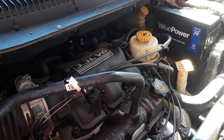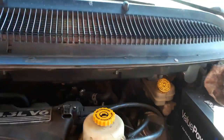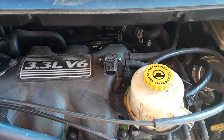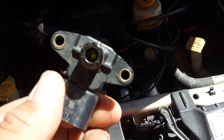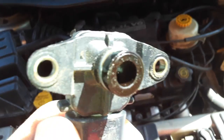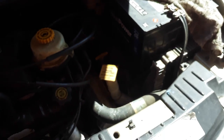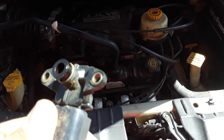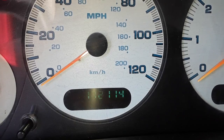Okay, so we're going to change that MAP sensor. First I want to pull it to see what it looks like. As soon as I pull it, we're going to see the condition of it — maybe it's just dirty and we can put it back on, or we just replace it. I pulled off the MAP sensor — it doesn't look like something that needs to be cleaned. This is probably vacuum operated. You can see in there it's got an oilish muck in there.